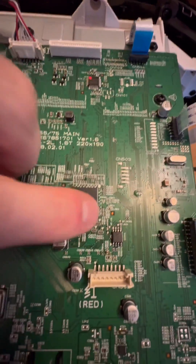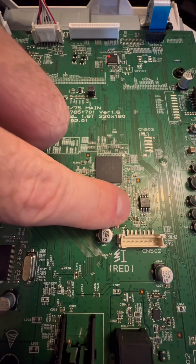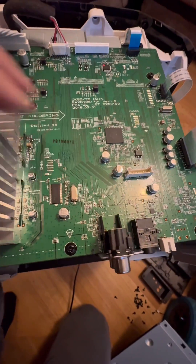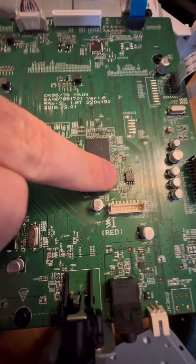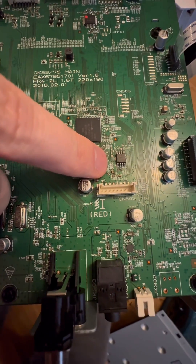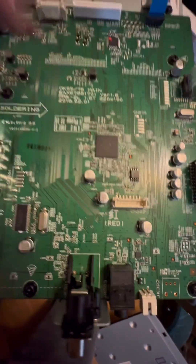When you get the back and sides off you've basically got this with all the screws in. That is the chip for one firmware but it's not the one that gets corrupted. The one that gets corrupted is on the back of it, next to the NAND chip. That's a smaller flash one - I think that's about eight meg, and the other one's a 16 meg chip. So yeah, don't flash that one, flash the one on the back.